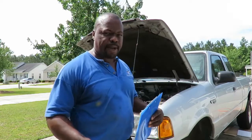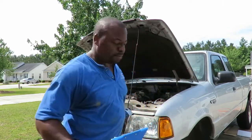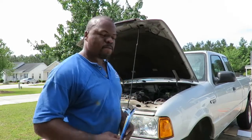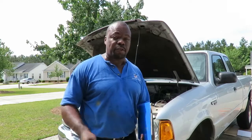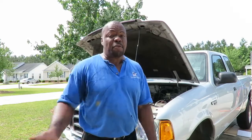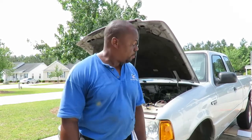Tay's cleaning up the back brakes, taking off all the brake dust because that can cause the squeal also. First thing you do, take off the cap to the master cylinder. I got one of the wheels jacked up already. Now, rotors — a lot of shops like cutting rotors and telling you you need rotors. Listen, if you step on the brakes and you don't feel a pulsation, you don't have to change your rotors. Leave them alone unless they're really thin. Don't let them keep cutting your rotors, because eventually you are going to need rotors if you keep cutting them. So if it's not shaking when you step on the brakes, leave it alone.